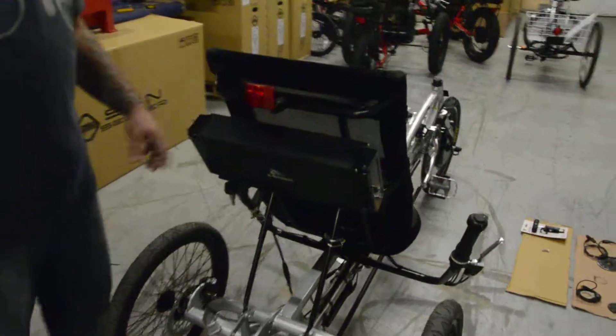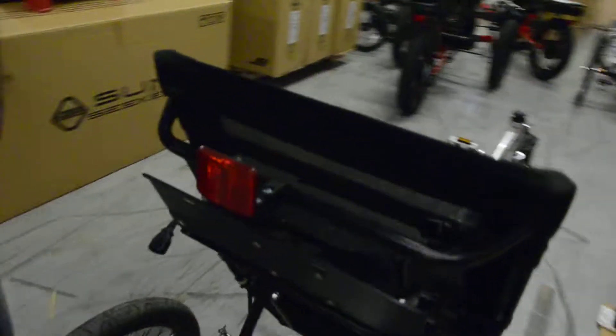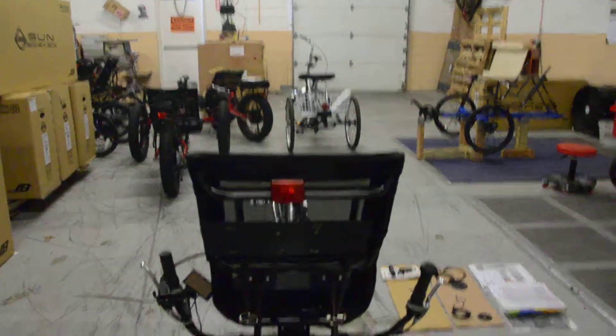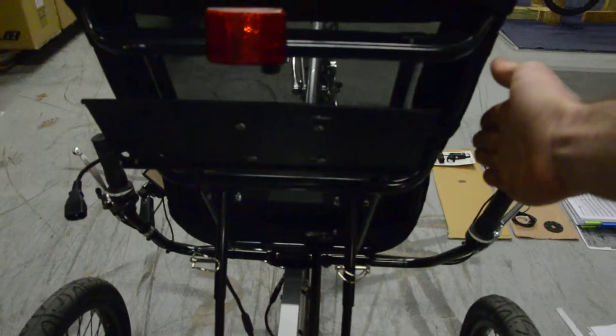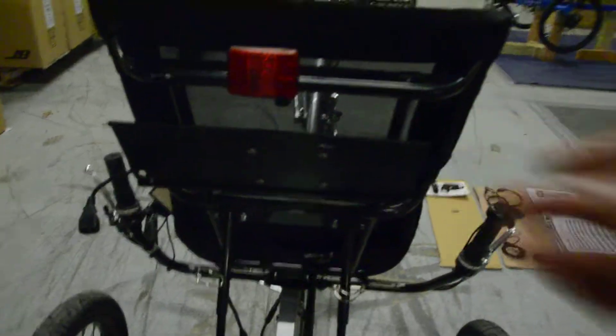When we're mounting the battery on this bike, we like to mount it to the water bottle bosses on the back of the seat. In order to do that, we use a special bracket that we make. When we mount it with that special bracket, we drill three holes in the back of the battery plate to mount it onto that bracket, and that gets the battery nice and centered. The plate has to be mounted off-center in order to center the battery on the bike, because the plate is slightly longer on one side than the battery. Mounting it off-center gets it all lined up.